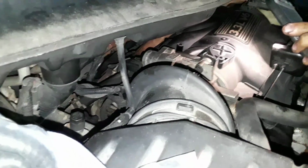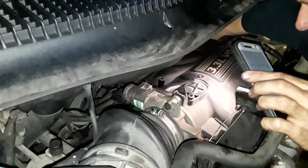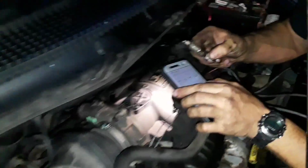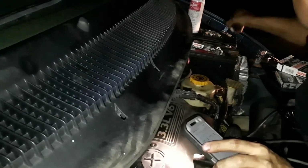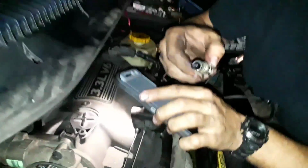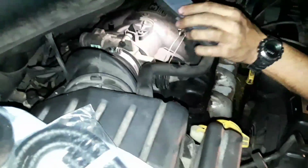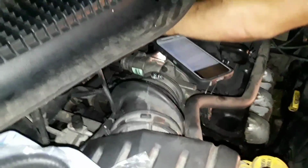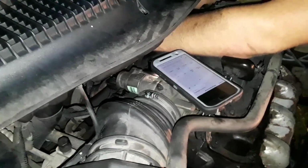You had shown me one of the plugs you took out. It was pretty bad. Yeah. What causes that? Misfire, carbon buildup, just in general, there's a lot of things. That one's not too bad. I mean, it's got debris on it, but some of them were pretty fouled up. Like that one right there. Yeah, completely black. Wow. Fouled up, a little residue. Probably from me driving around like, hey, please don't die. What not to do.